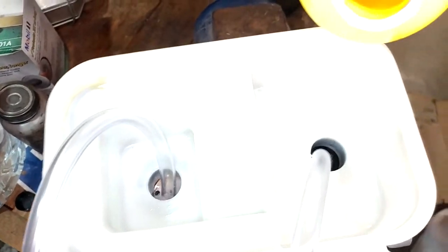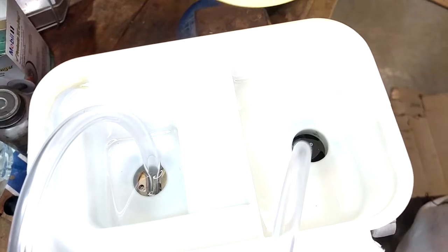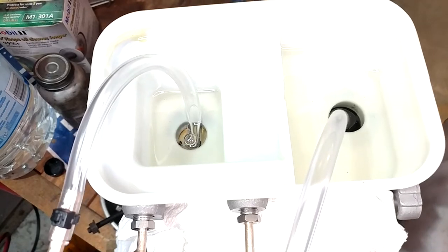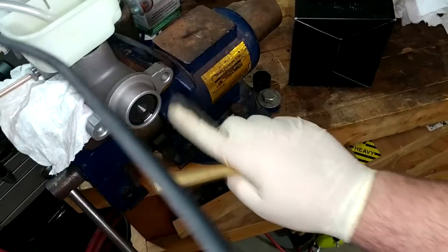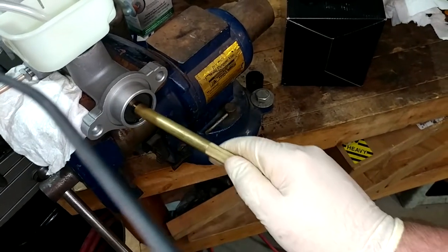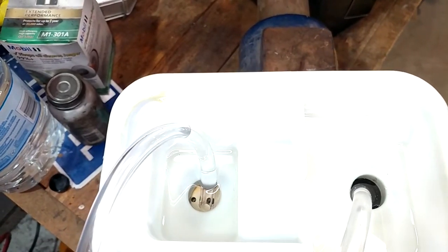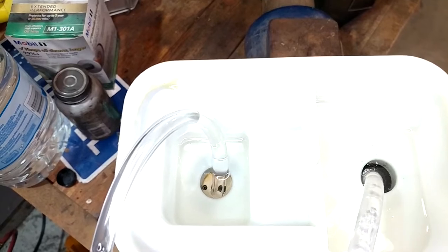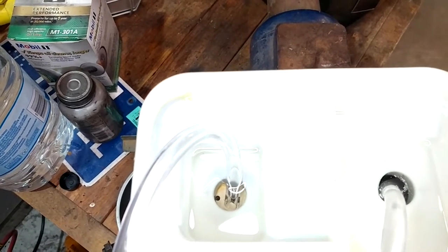The method here is pretty straightforward. We're going to put some fluid in this guy — I'm not going to go crazy right away just in case this happens to be defective new out of the box. To run the piston, I just happen to have this brass punch that fits in here nicely. The idea is to do this slowly. And there you can see it pushing a ton of air out.